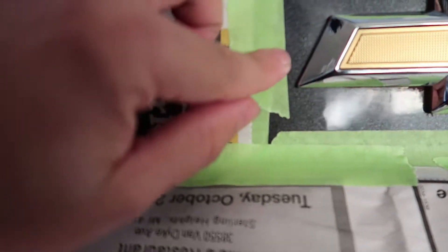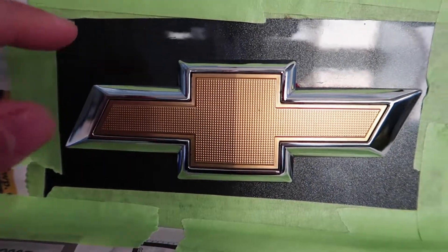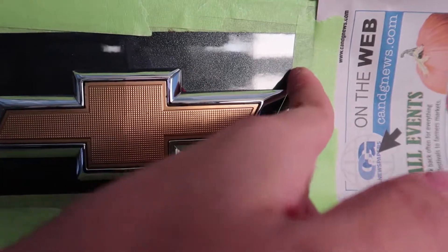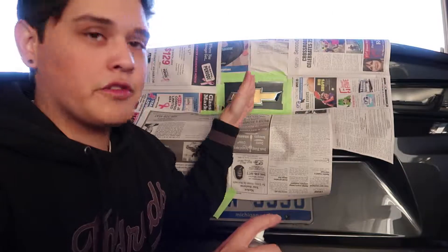Make sure that none of the edges of the badge are touching the tape or the newspaper — leave little gaps so you can actually get through to them. Now these next steps are pretty important. You're going to want to take your Plasti Dip or Flexi Dip and shake it up real good so it's not watery or runny. And the whole time you're going to want to do very light coats, because if you get too heavy a coat it'll start to water up and drip, leaving a drip mark. Shake it and start off with a very light coat.